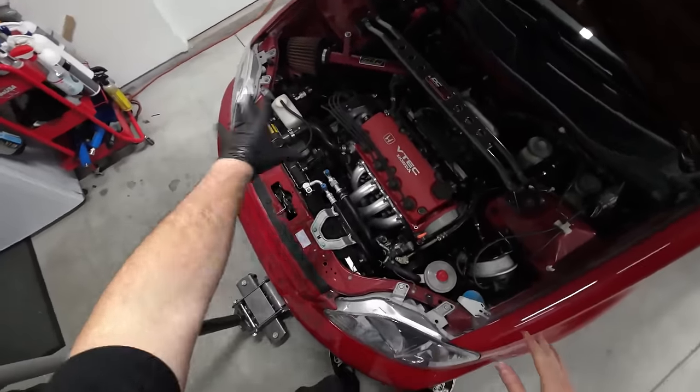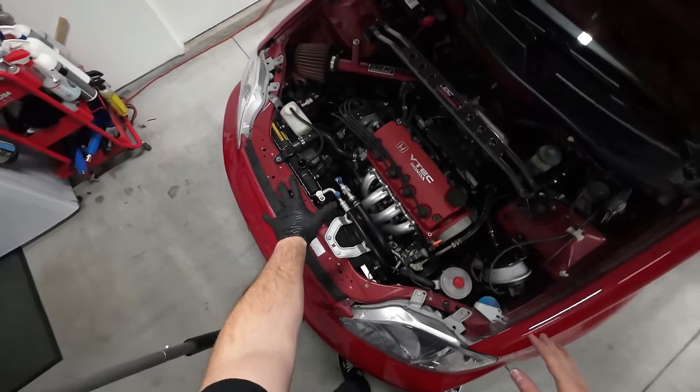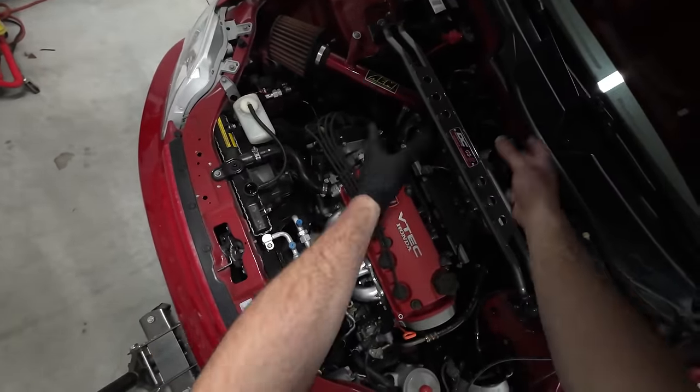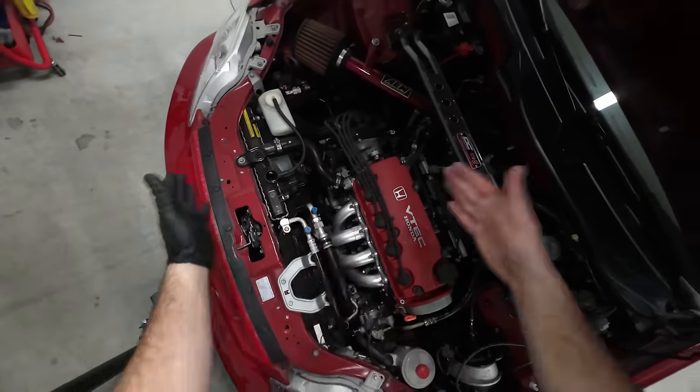We still have a little bit of trickling every once in a while, so I'm keeping the pan under there. Most of the rest of the coolant that's going to come out is going to be near the thermostat once we remove that housing, so we'll simply move that pan back there.